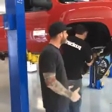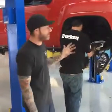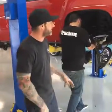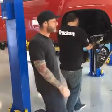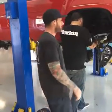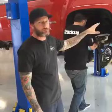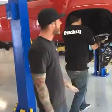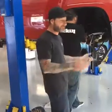But what we're doing today, we have a 2010 GMC Sierra, just standard cab, and we are lowering it. Jeremy's lowering it, doing a 4.7 drop with a DJM suspension component. And the front's just an upper and lower control arm that gives it a 4-inch drop. You don't have to change the spring, strut, nothing else. Just an upper and lower control arm, supplied with new urethane bushings and new ball joints.